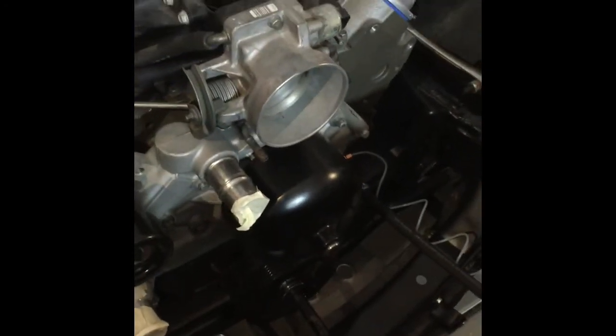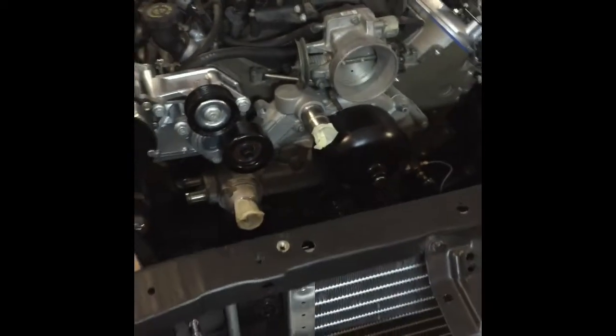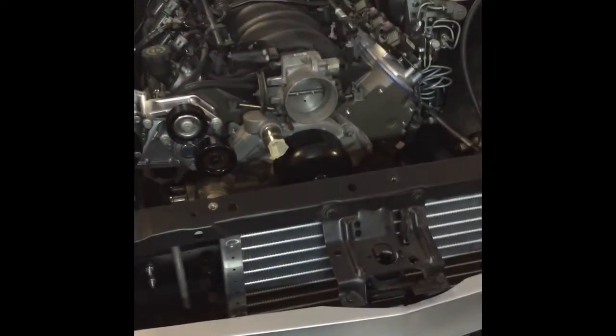One of the things I read that's important is to make sure you turn the crankshaft a couple of times when doing it, so you can line all the oil ports up and get oil up to the valve covers. I'll do a video when I'm lubing, too.